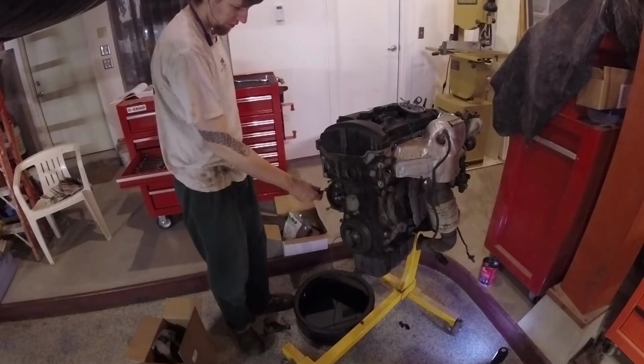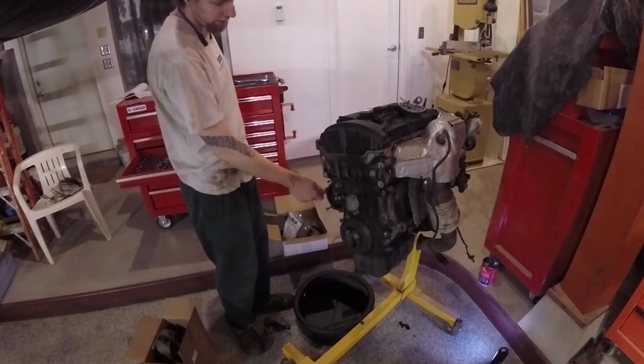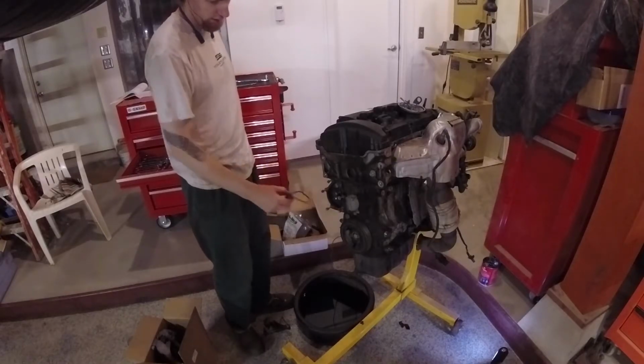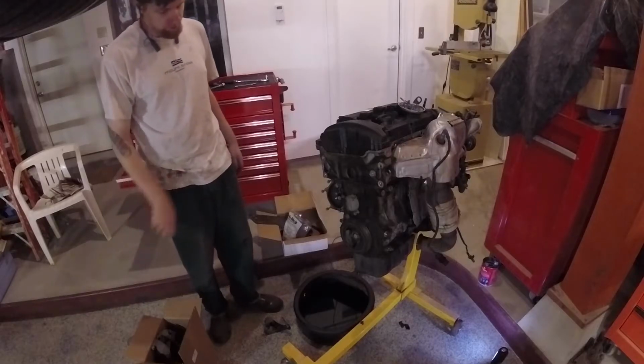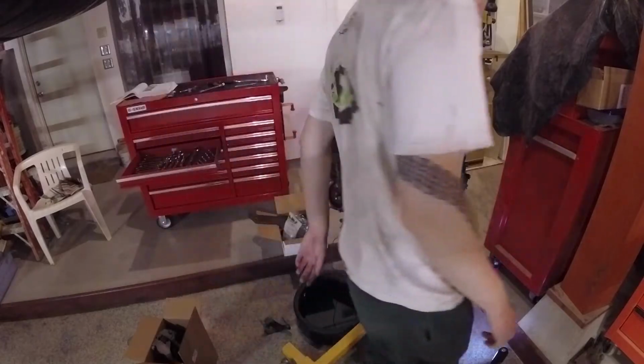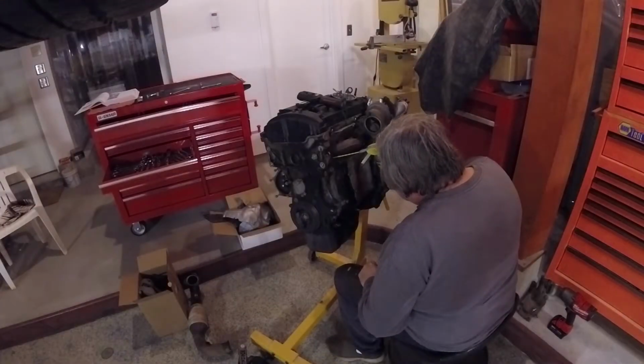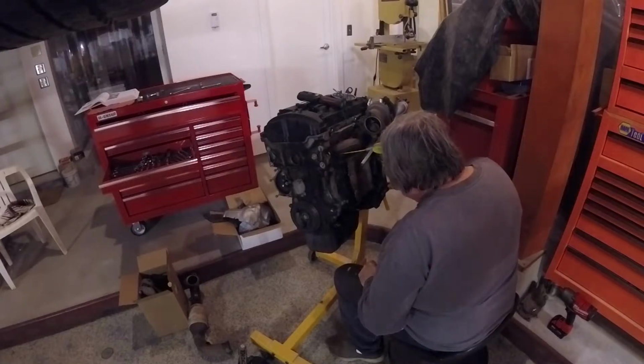And they can fail in a couple of different ways. The ones with the steel impellers, or the metal impellers, also have metal front casings. They'll last a lot longer. Do note there is an O-ring. Remember to grab that, as if you forget it, it will make things a bit of a pain.